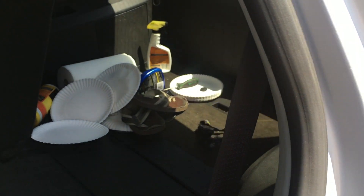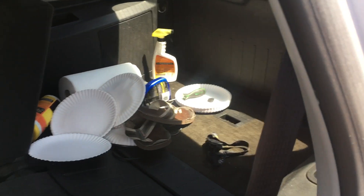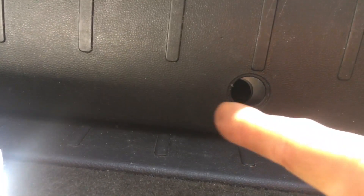We can't get that rear hatch open — the electrical portion's probably broken. I actually had somebody reach out to me on another video I made and ask me how you do this, so that's why I'm making this for you. We're gonna put down the rear seat, crawl in, and you're gonna see I already popped the little bubble out of there — that's that black piece, I just used a screwdriver and popped it out. Then hopefully you can see that hole that's in there. Stick your finger in there and push it to the side — you're gonna push a little pin. You can do it with a screwdriver if you like, and then push up. Super simple.